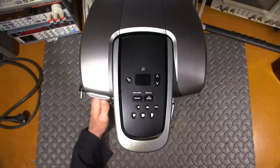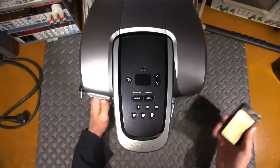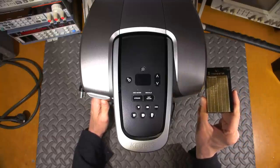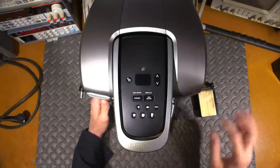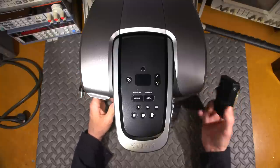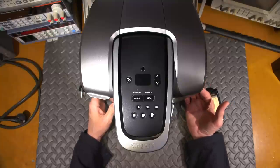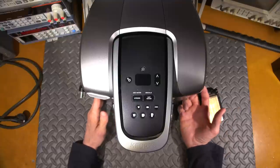I went around the place with this little AM radio, which works great as a sniffer - a very sensitive little AM radio. I went down the breaker panel with it until I came to a breaker that was noisier than the others, located where that breaker was, then went from the breaker to the outlets attached to it and found this thing. How do you know it's actually making the noise? Just unplug it and it completely disappears.